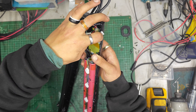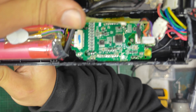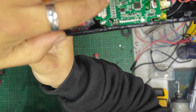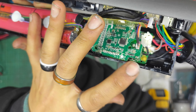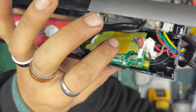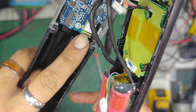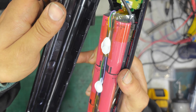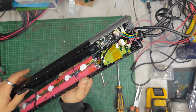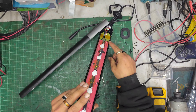I've disconnected some plugs in doing this, but that's fine — this plug goes there, that plug goes there. We've got our motor phase wires: yellow, green, blue. Our motor halls seem to go to this plug, and this uses the same main connector to the board. I see our battery charge port here — we've got our positive and negative and our two sort of control wires. One of these control wires on the charge port is labelled CAN high and CAN low — CAN H and CAN L. So that's pretty much automatically a no-go, isn't it? And then we've got the BMS itself down here.